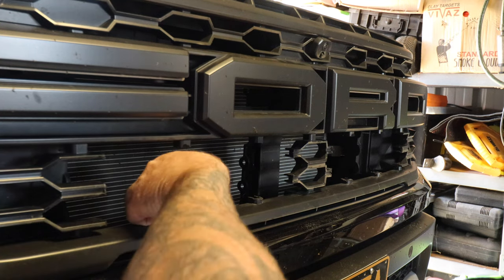So we're going to put in the screws and stuff now, all the black screws. These are the black screws, but these are tamper-proof ones, so they also came with a keyway piece here as well, so that way no one can try and take your lights out unless they have one of these keyway sections. So I'm going to screw them into the grill. We're going to do a 3.5 mil pilot hole into there to get the screws in into each thing. So we're going to do that now.